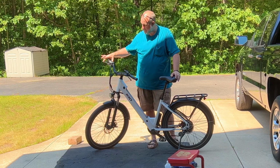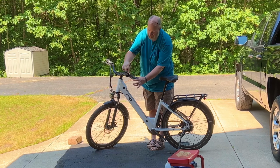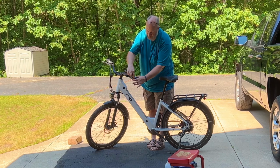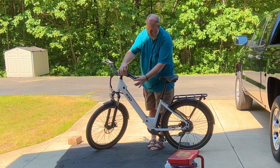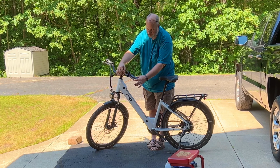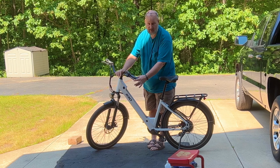The only other thing you might want to do is when you pull back these, you want a good thumb width here. Use the barrel adjuster to get the width the same on both sides. And you do that by screwing them out and then locking them down with the lock washer. I've shown that in other videos.